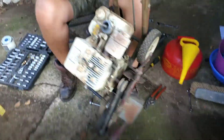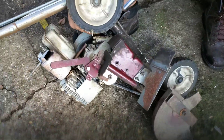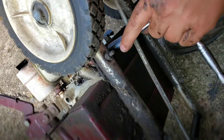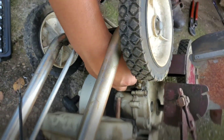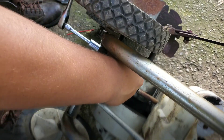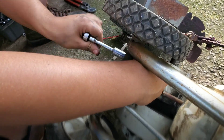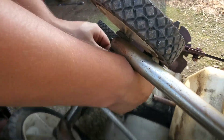I think we'll just put the edger up like this to get the last bolt out of there. On this last bolt it's kind of tricky, depending on your machine to get to. Half on top, 7/16ths on the bottom — I guess these are the original motor mount bolts because this motor hasn't been off since this machine was built. Sometimes these are tricky, and a socket extension is recommended for more leverage. I think that pretty much does it.